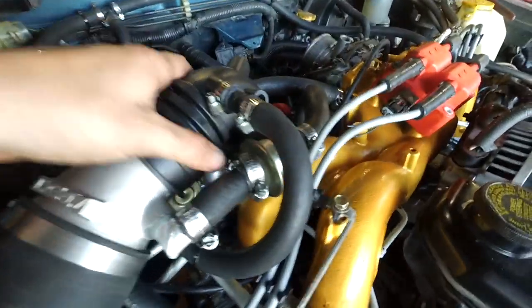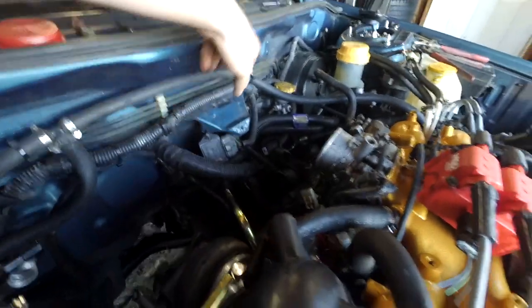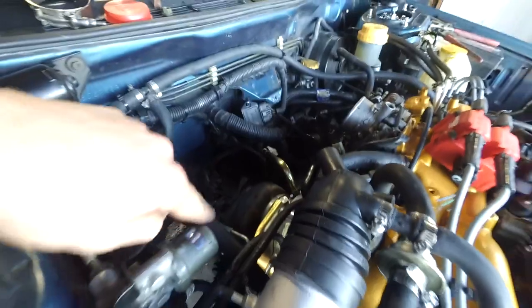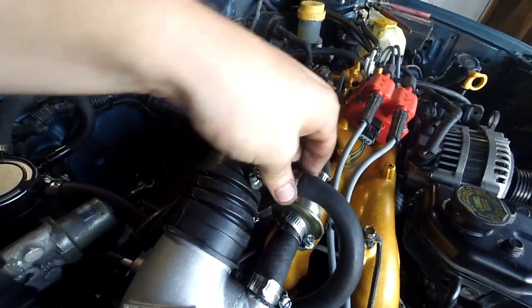I started fitting up my intake. So this is the Apexi intake. It goes on here. I used some of my old hosing, and I started setting up the catch can. So I got the valve covers T'd together right here. Go in there. This one right here is what goes back into the intake. I got little fittings for that, and I just tighten that up.